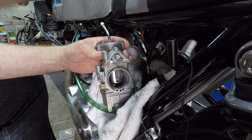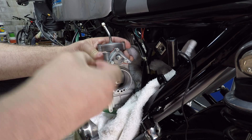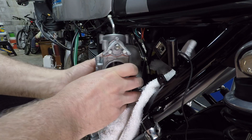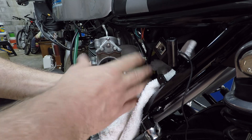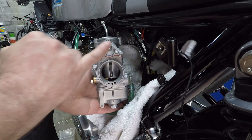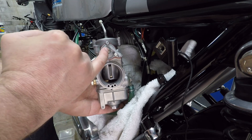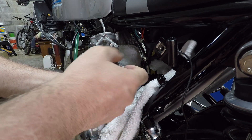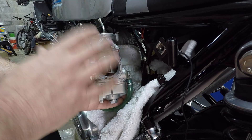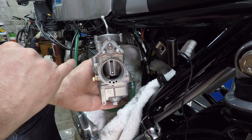I just restored them to what they were from the previous setting. Then I went out and did a whole lot of AFR testing to see how the bike's running. I decided I should actually adjust these because it was unknown what they were, and I couldn't be sure the behavior on full throttle was the expected behavior. So the first step is to adjust the accelerator pump.